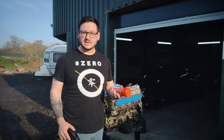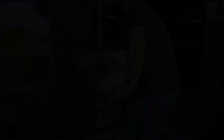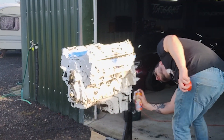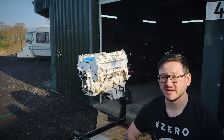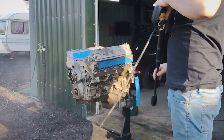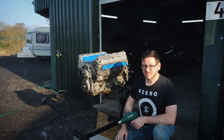Now back to the LS. What I'm going to be using to clean this up is some oven cleaner and a pressure washer — very simple. I'm not looking to get it totally sparkling clean, but this should just get off any of the really baked-on grime and dirt. Let's spray this on, leave it to dwell for a bit, and then power wash it off. I probably wouldn't recommend this for an engine you're planning to just rebuild as-is, but I'm hoping to replace all the seals and half the parts on it anyway, so it's really not a big deal. Just going to let that dwell and then blast it off.